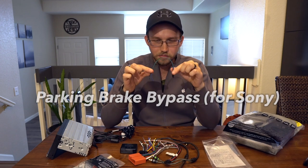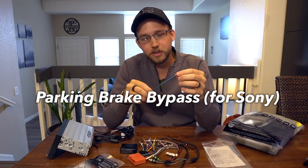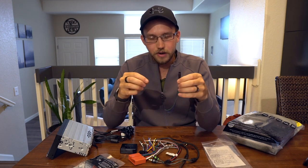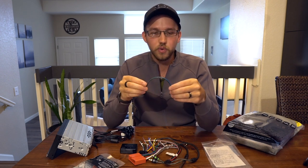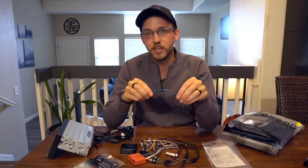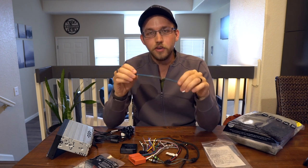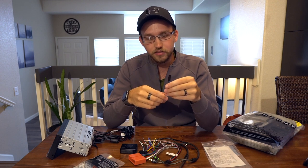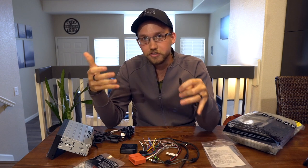This little device is the parking brake bypass. They're made per head unit brand, so make sure you get the Sony one, the Pioneer one, whatever it is. Theoretically you can just ground the little grass green wire from the head unit and that'll do the same thing, which is allowing you to control certain things like typing text into maps and setting up a new phone on Bluetooth without being parked. Obvious disclaimer — don't be dumb. Let your passenger do it, or in my case, I'd love to be able to type in maps at a stoplight without having to put my parking brake on.